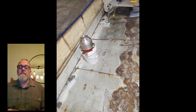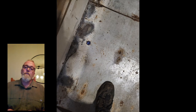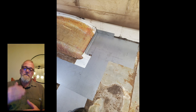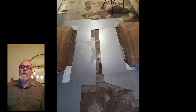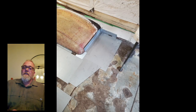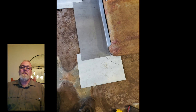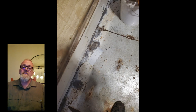I'm going to show you a few photos here. I numbered them all and took pictures so that I could remove them, treat the floor, treat the rust, and then seal in the patches. I bent all these patches — all this metal. I made my own bender. I didn't buy one; I literally made my own. I overkilled it — I went way over — but I don't ever want to have to do this again. The last thing I want to do is rip out a floor because of rot. I want it to be secure, sound, and able to withstand the test of time.